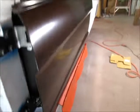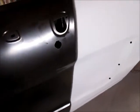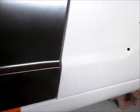I've got the door lined up — it's hard to see at this angle, but it lines up really close. The reveal — the combination of the gap on the back edge of the door and the gap at the bottom — looks pretty good.